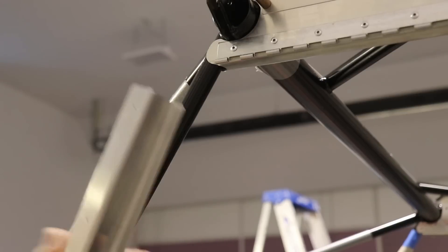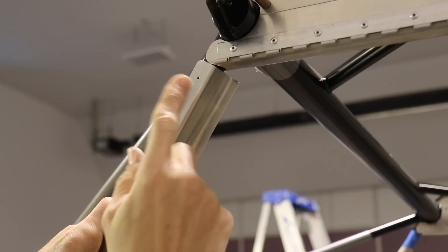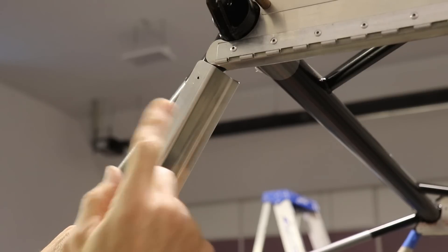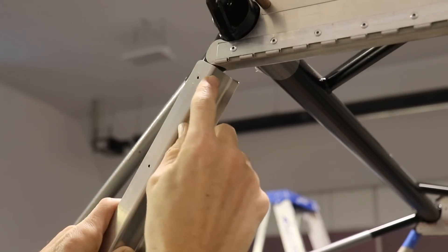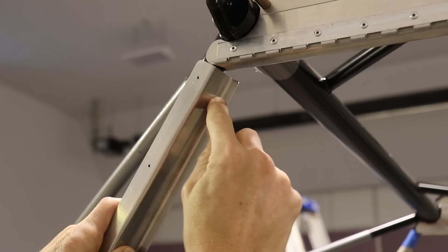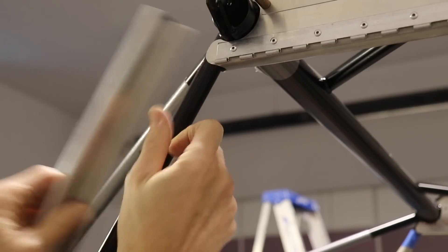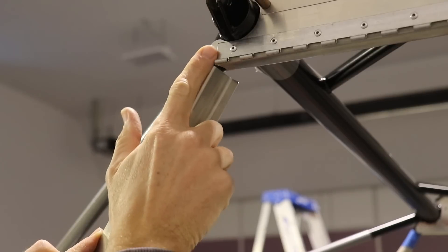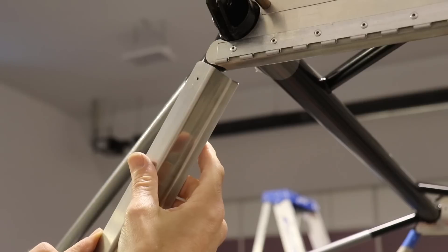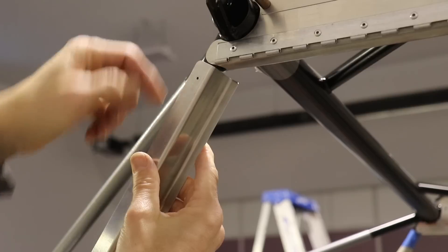I'll show you where I screwed up — it's the very top. What I did is I put this up here just like this, and once it was positioned I cut the bottom and I thought I was good to go. But I went over to my cruiser and I noticed something I did differently there which is much better. I need to cut this part out here so that this goes up, because that windshield is going to go all the way up to the spar. You want this to cover all of the windshield — it would work like this, it just wouldn't look as good to have it end here and see this open space of the windshield with no trim on it.